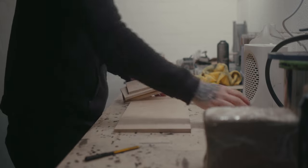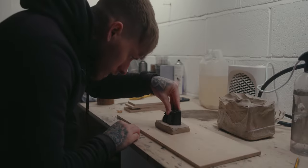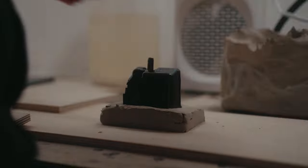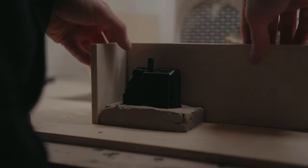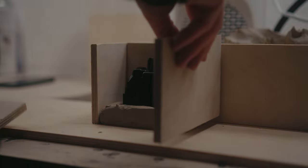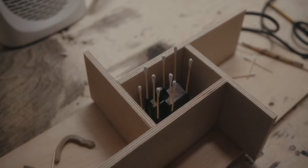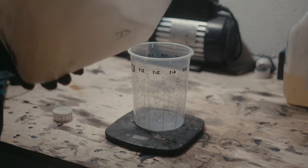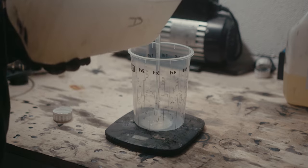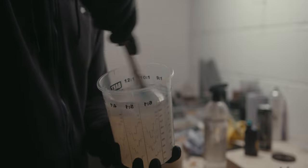This is going to be a two-part silicone mold. The first thing is to embed the part in clay where I want my split line between the two halves to be — I've already calculated this by looking at the part for any undercuts that would trap it in the mold. Once that's done I can box it all in and add my cotton bud air holes, because part orientation and air holes need to be considered — when the resin goes in there's going to be air in the mold, and the air needs to escape.